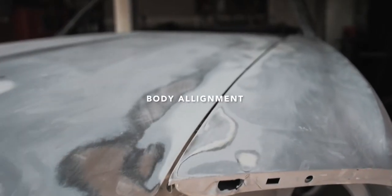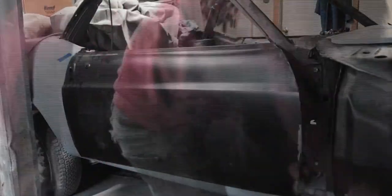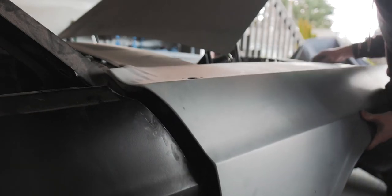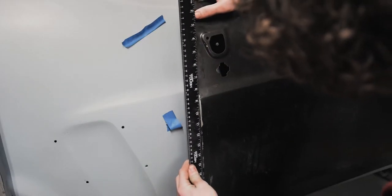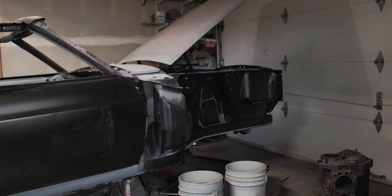I started off by adjusting the rear door gaps on both sides, and this is the place that you always want to start at. You want to go from the back forward. Once those were good, I put the fenders on and tried to fit the fenders to match the gaps as best I could. You want to make things tighter than usual because it's easier to remove material than to add it. It took a lot of adjusting because the gaps didn't match up very well, and I just got to a point where I called it good.